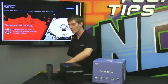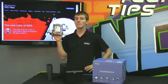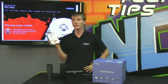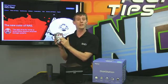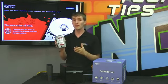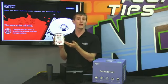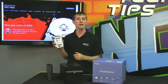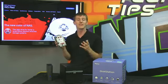The conclusion of this episode is pretty simple. If you're running a NAS environment, pick the RED drive. If you're running in a RAID environment as a consumer, pick the RED drive. It's really not that much more expensive than a standard green or blue drive. You get 24/7 tech support, a longer warranty, and enough performance for what you're realistically going to be doing. Even a several-hundred-dollar RAID controller in a large RAID 5 is not capable of writing more than around 70 to 80 megabytes per second, which this drive is fully capable of doing — and it's a fantastic value.